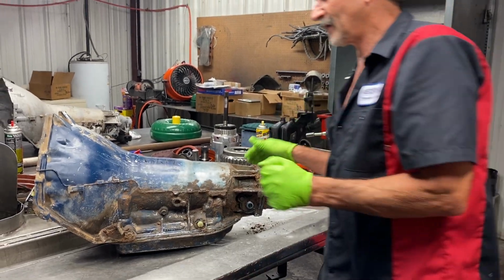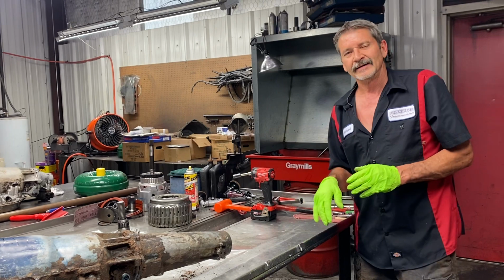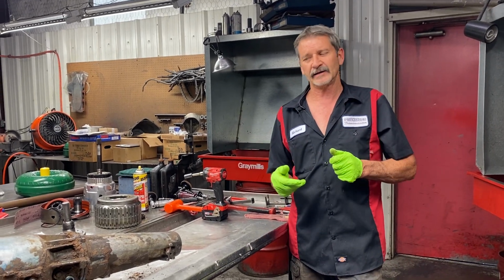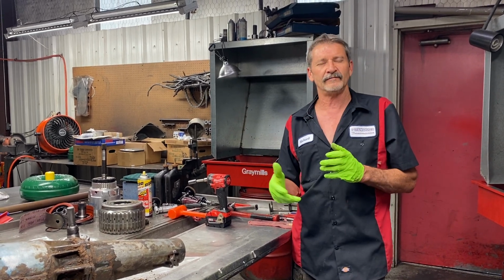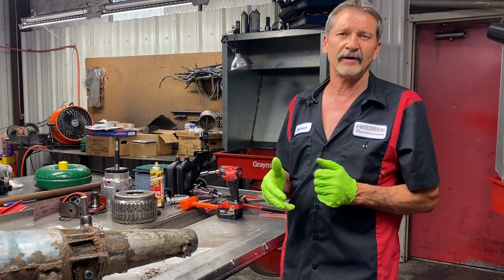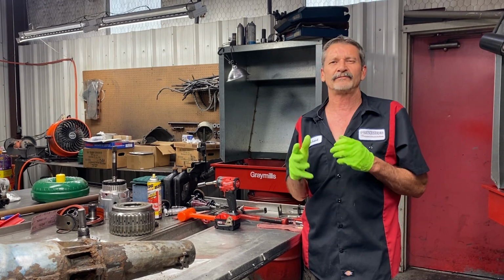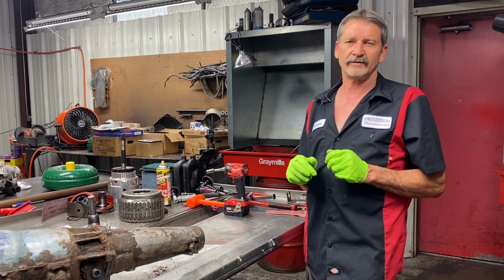Oh man, I wanted to do something real quick, guys, before I got onto this. Since we post videos day to day, we tore down a 6L90 yesterday and did a video of it, and it had the 1-2-3-4 clutch burnt up in the tranny. Anytime we have clutches burnt up in those trannies, we have to look for cracks right off the bat. It's got something to do with a crack.